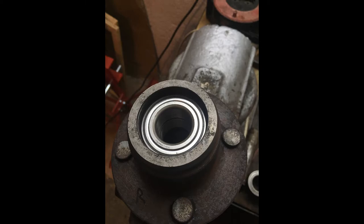The new bearings are in, and as you can see the rotors popped off during pressing. Here's an upside-down shot of the bearing with the safety ring in place — the new bearing set came with new safety rings and even a spare. After all of this I reassembled the car: put the rotors back on, pads back in, put everything on, and hammered the new dust caps in.